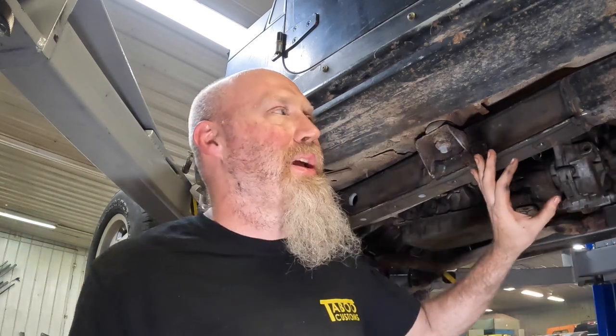So anyway, if you are looking at coating this, obviously we're going to go in and coat it. What we typically do is a straight spray prime primer coat. We'll do that pretty thick. You want it thick. You want the mils on there to try to keep the rust from occurring, and then we will do a spray top coat. We don't do undercoating or any kind of wax coating or anything like that. Honestly, the frame inside, you're already there. You're not going to get the benefit necessarily out of it, and in some of those, it is more detrimental than beneficial.